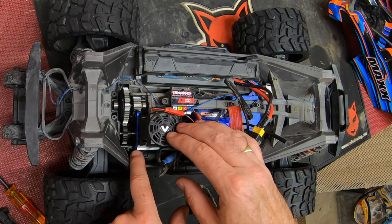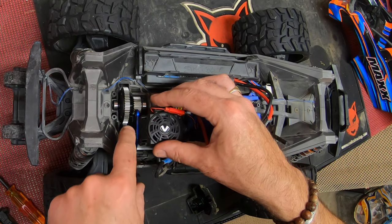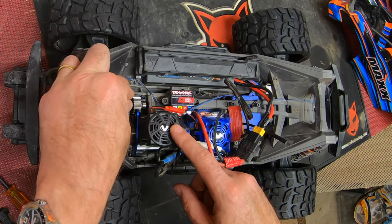The only thing to make absolutely sure of is that the pin is lined up with the right hole in the bottom of the motor mount, because when I first put it on it was standing too far out and the gears weren't actually touching. So pay a little attention there, but it's dead simple — just check the gears are meshed.